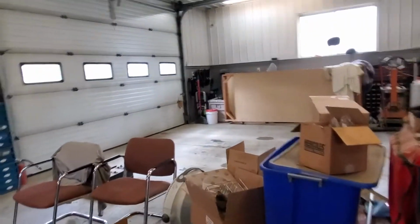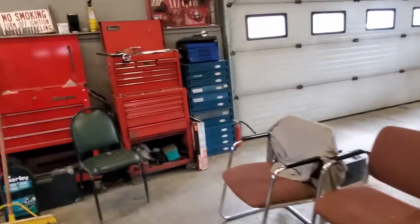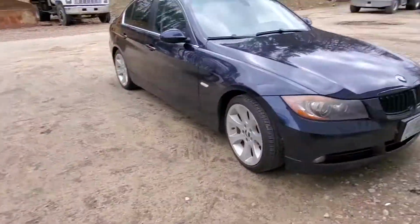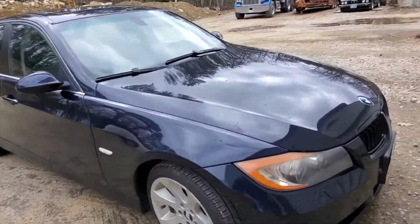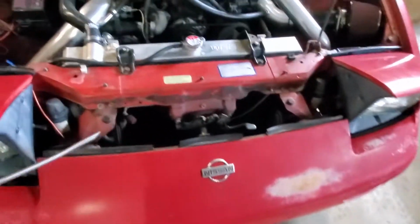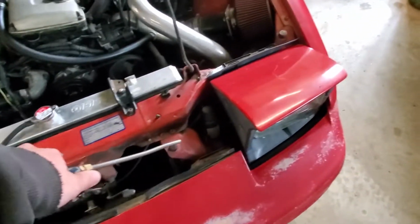Now, the 240's battery is dead again, so I'm not sure what that is. But I know it was overcharging because of that alternator, but I don't know if that killed the battery or what. It was almost to 19 volts with the car running, so it could have cooked the battery, I guess. Sheesh.